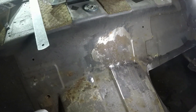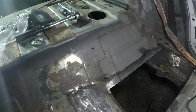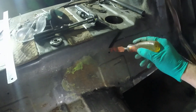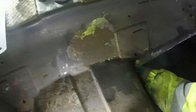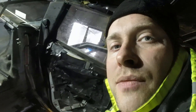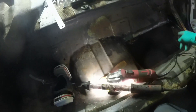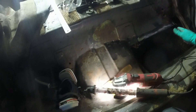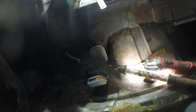That's really very annoying - it begs the question, do I chop the whole thing out? And I think I already know the answer - that's going to be no, because it involves doing all the seatbelt mounts, and what you can't see from this side is down here there's a big reinforcer I can feel but can't see. So I don't want to disturb that bit. That bit is just a simple skin, so I think I'll just chop a patch to go over there - call it evens. It's not a concours car as I've said many times before. I keep talking about this police car that I did - I repaired this area in that car as an invisible repair where I seam welded it and linished it flat and smooth from both sides so you'd literally never know the car had been repaired there.